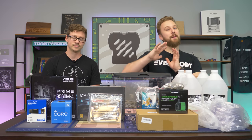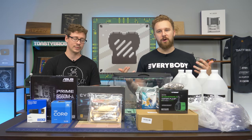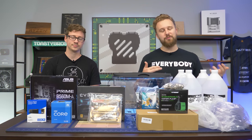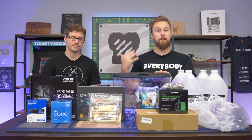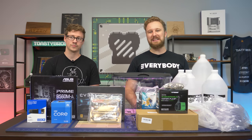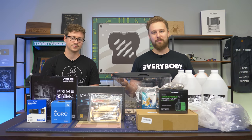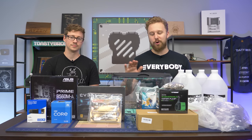It's not necessarily recommended you do this. The general thought is if you submerge all your parts in liquid it'll run cooler — for the most part it does — but there are trade-offs. Your components are forever stuck in there unless you want to take them out and have them drip dry for months to use them in another case. And it's just really, really messy. We'll probably spill some somewhere. There's going to be oil places — it's the downside of mineral oil PCs.